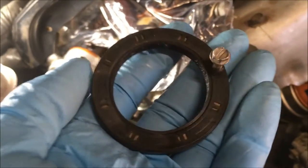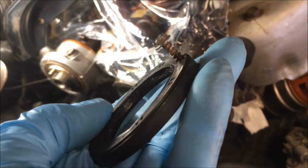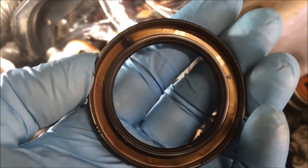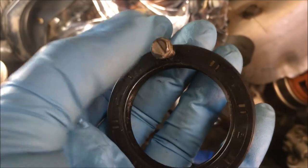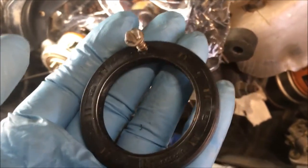Now, the crankshaft seal — that's how we removed it, with a screw. We drilled a hole into the seal, because behind the seal is a metal plate right there. We drilled a hole into it, put a hex screw in there, and we're able to pull it out with, you know, like a cat's paw nail puller type thing.